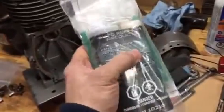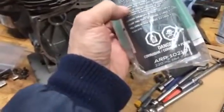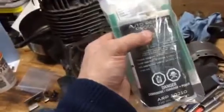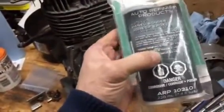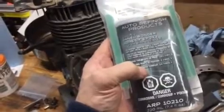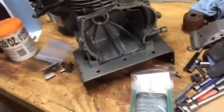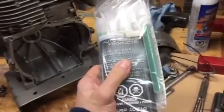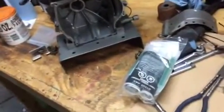It's normally $80 a tube. There's a place about 40 kilometers away that sells a no-name version — not 3M — for about $40 a tube. The 3M product is about $79.99 for a 200 milliliter tube. This is called Auto Refinish Products and it basically works the exact same. It's a 90-minute working time, four hours clamp time, and 24-hour full cure — so I'm going to let it sit overnight. But if you use a heat gun on low and heat it up, it cures much quicker and is supposed to be stronger. There was a demonstration at a body shop here in town where the guy used a heat gun on low and it actually cured quicker and baked harder. They say it really should have heat to it.